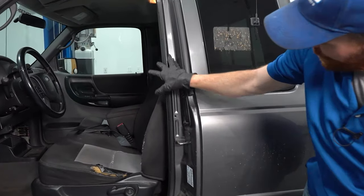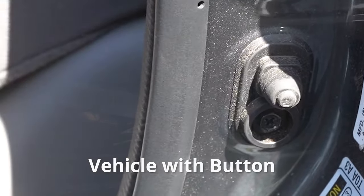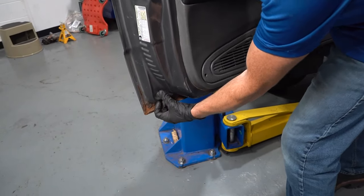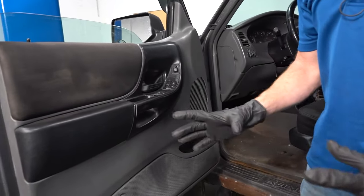If that didn't fix your issue, the next thing I want to talk about is the dome light switch. It's common for there to be different dome light switches. A lot of times you might have a push button switch, so if you feel along your door jamb, you might find a button on some vehicles. On this one, I can go around the entire door jamb and I don't feel a button anywhere. I'd also want to check the door itself — feel for any type of button. I don't feel anything along this, especially inside the door jamb, so that tells me this one doesn't have the door button.